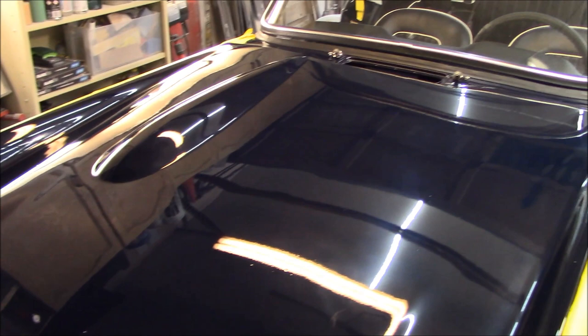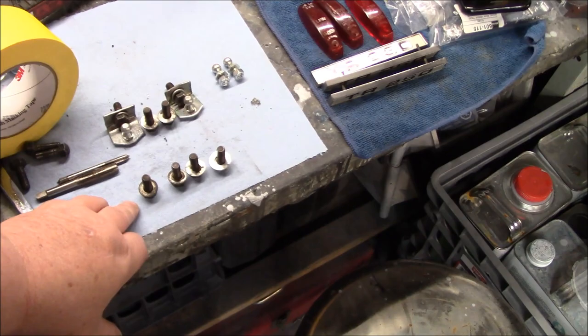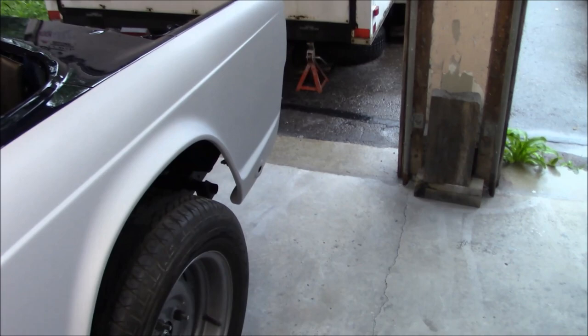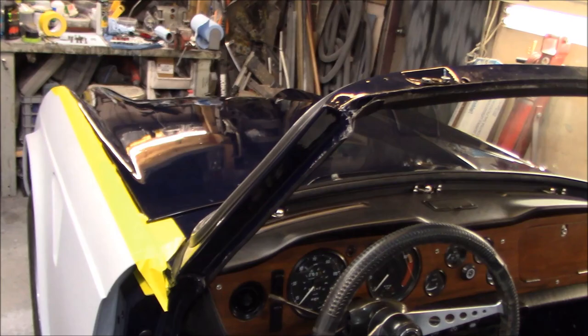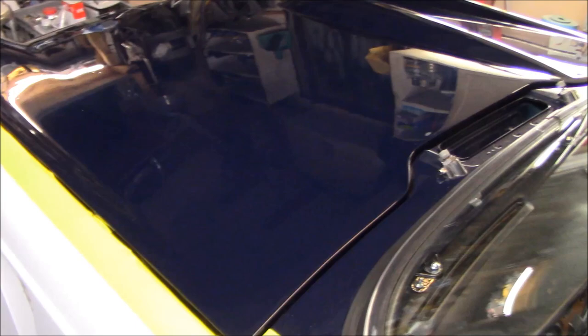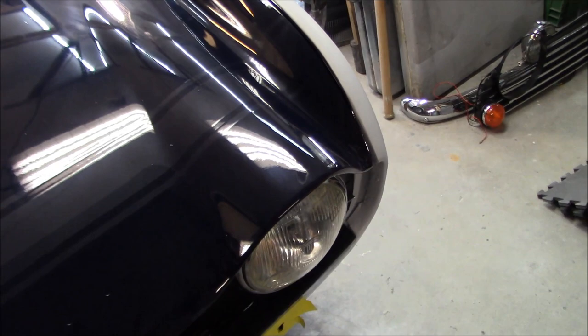Welcome back — now Thursday — and we're just about to pick up where we left off. The bonnet is just resting here on the body tub and we're about to add the hardware to the hinges. We're going to get this bonnet fitted up fully. As mentioned previously, I need to do the marker light and badging on the rear fender, and before I start drilling and vibrating the body tub I wanted to make sure the bonnet was bolted up so it didn't slide off. So first job for the day is to put the bolts in the hinge points.